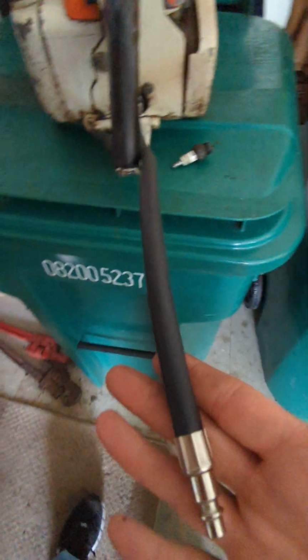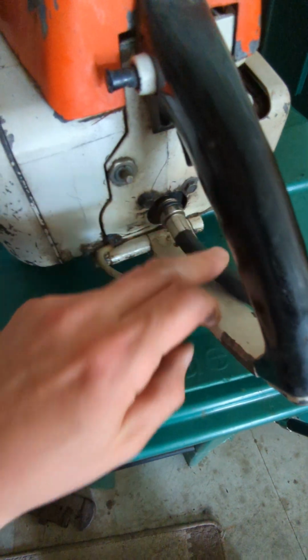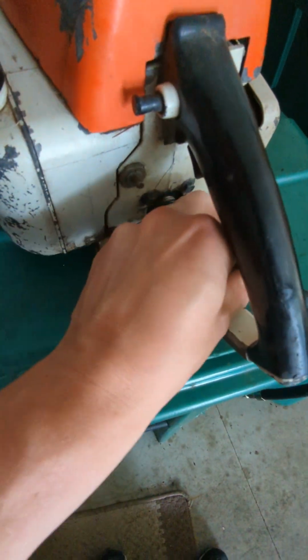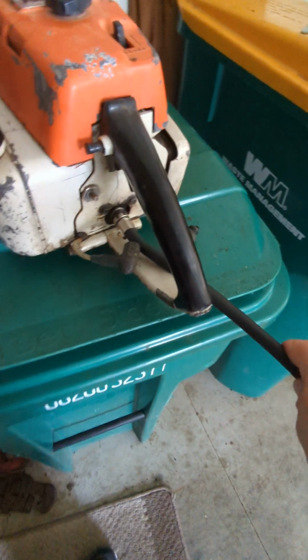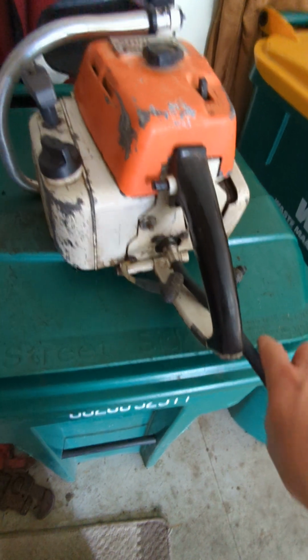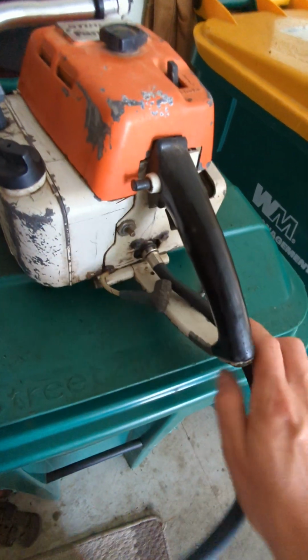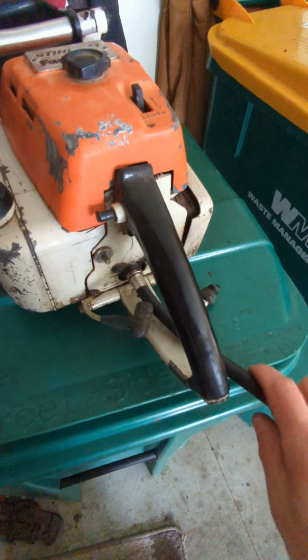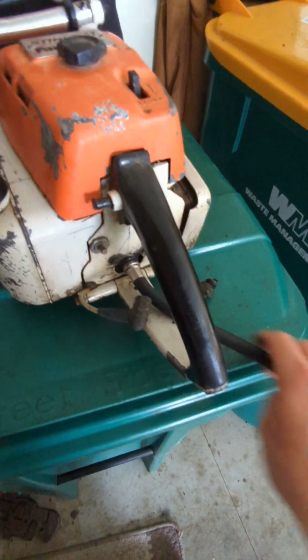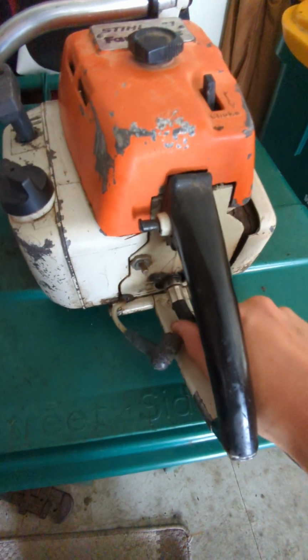Now, this comes with a tube, so you can see I've already got it started, because this one you really have to bend. You have to kind of bend it way down and get it in there, so it's kind of tough. And then you can kind of angle the hose reel off like this, and spin it until she's hand tight. It doesn't have to get overly tight or anything like that. You just don't want any air bypassing what you're doing, because then the reading won't be accurate. So that's about hand tight.